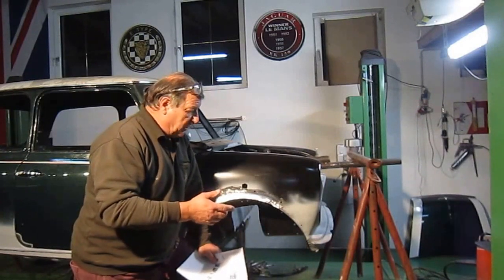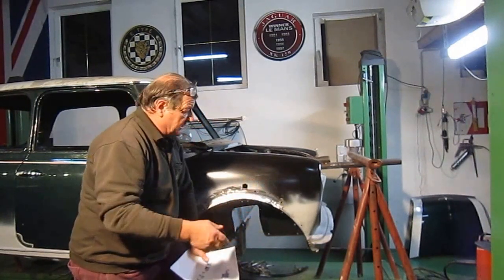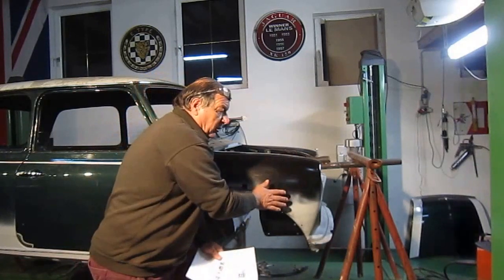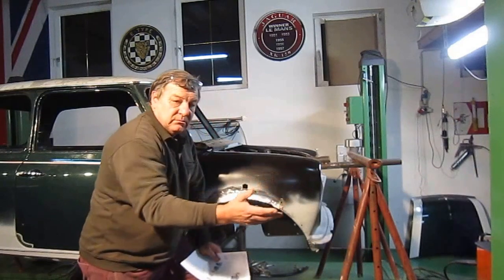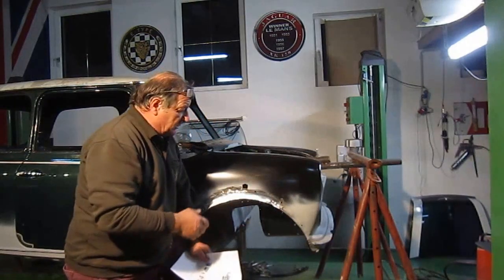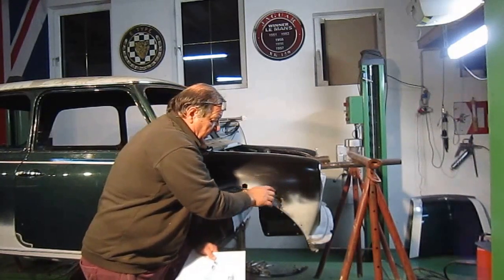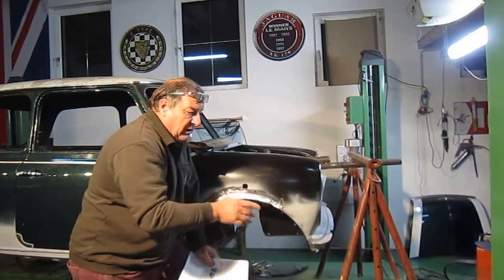It has a probe on it where you can heat the metal to shrink it. You can heat the metal and then put cold water on it to shrink it. The normal system is you have a grinder with an aluminium or stainless steel convex disc, rub it all over almost like grinding, put some heat into the metal, then put cold water on it to shrink it. With this one, you can put the probe all the way around — it kind of glows and heats the panel up very quickly, then you just quench it. It's also got all the equipment for pulling out dents — there are different types with discs or washer-like attachments that spot weld. You can put a bar through and pull it with fingers on a slide hammer, which it has.